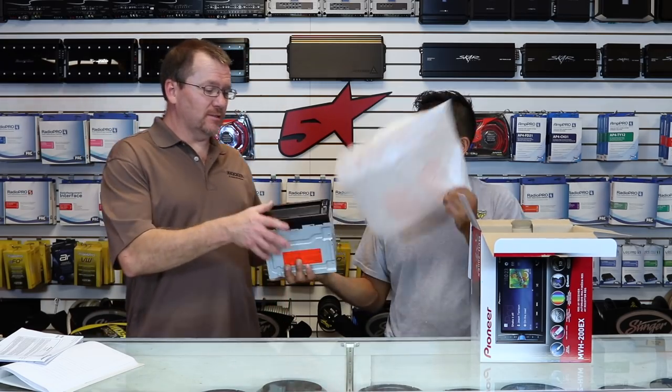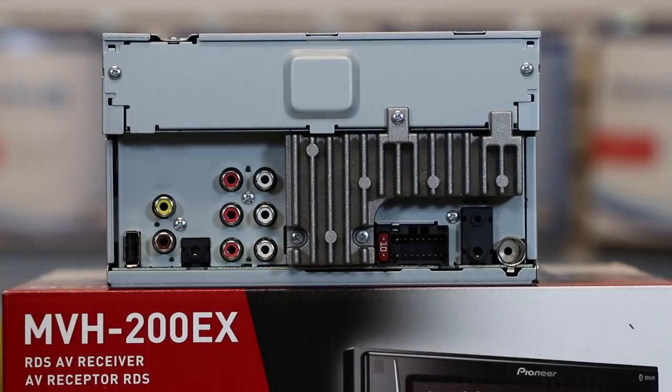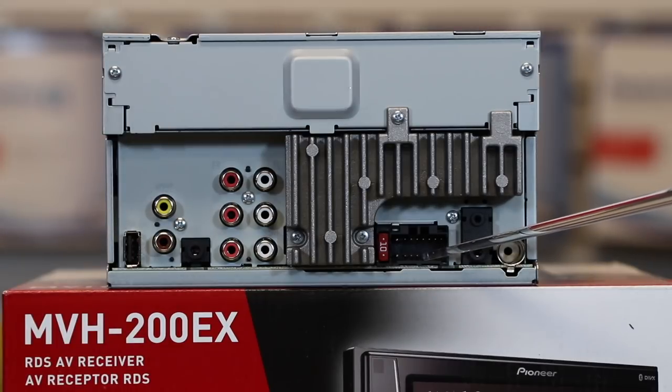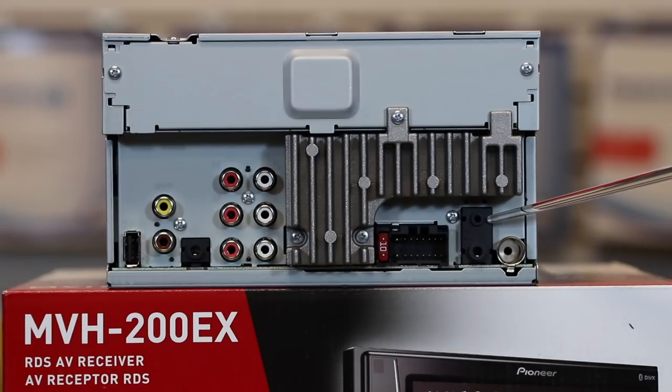You can get that at pioneerelectronics.com. Looking at the back of the radio, we have the one and only USB — it is a 5-volt, 1-amp. Next to that is the brown RCA, which is your rear-view camera input. Right above it, the yellow RCA is your video output. You have the auxiliary input, 6-channel 2-volt output starting with subwoofer on the bottom, then rear and front. Next, the main power plug input. The 1/8-inch jack is for your steering wheel control inputs, the smaller jack above it is for the Bluetooth mic, and then the FM antenna.